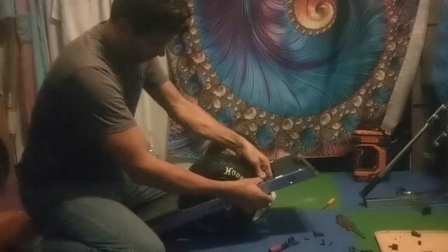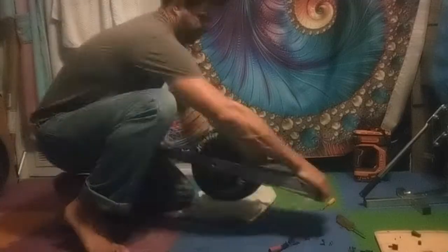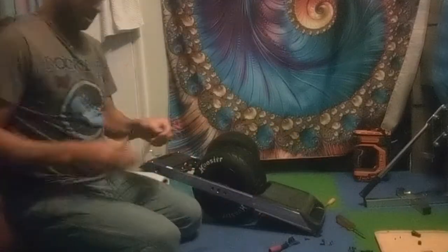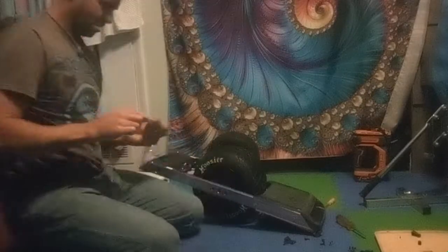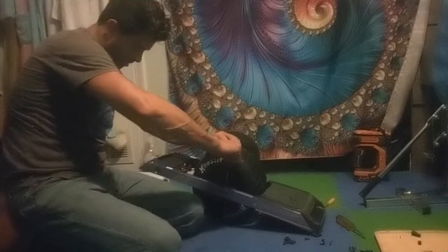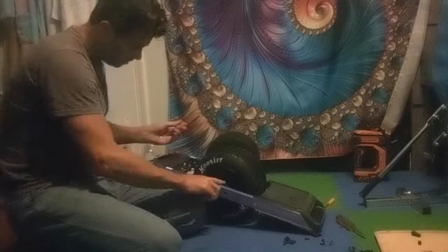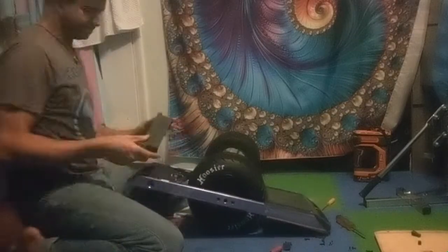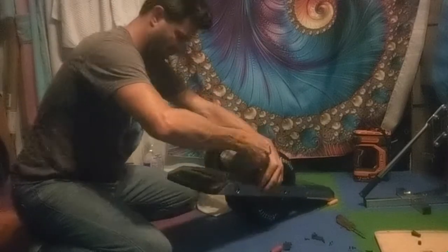I'm now hooking back up the wires connected to the hubless motor. It's a little tricky to do those cylinder connectors — refer to another YouTube video for that. Now putting that plate back on that protects the heavy-duty wire going from the battery up to the controller. Be sure that seats really, really well — that is an important piece and you don't want to strip it out. Then put the wire holder back on and slip the fender back in.